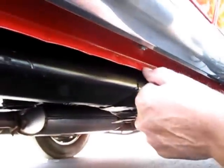I'll give you a quick visual on this. The light will come in here shortly. Give it a minute. There we go. The floor pans are not heavily undercoated or gucked up with any aftermarket junk. Frame rails are nice and clean and original. Body bushings look very good. Original pinch welds are nice. They're not swollen. Up in here, the floor supports above the frame rails are really nice.